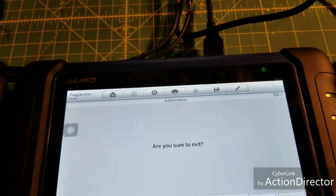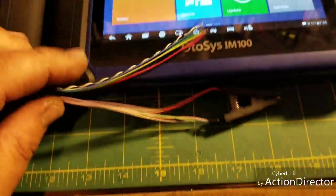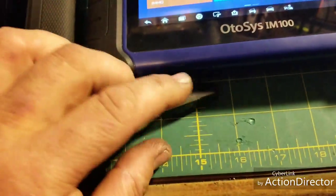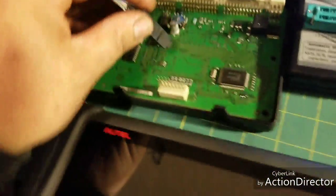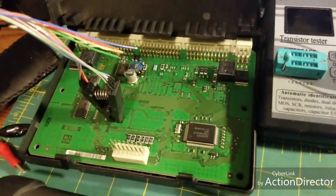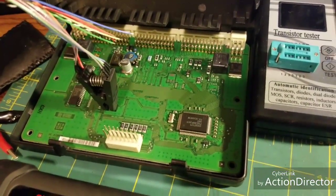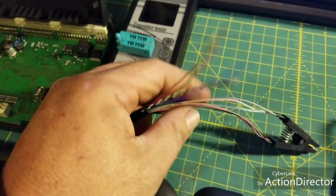Let me go back because I'm kind of jumping ahead. Accessories-wise, it comes with a really nice — actually one of the best I've seen, and I have a few name-brand ones — 8-pin EEPROM clip. Here's a body control module for a GM I just fixed for a customer the other day, and the clip is actually way nicer than the ones I have. It also has the ability to solder directly to a microcontroller, and it's all in one adapter.